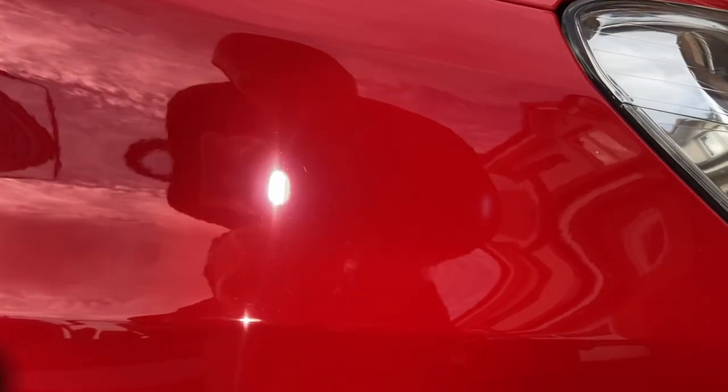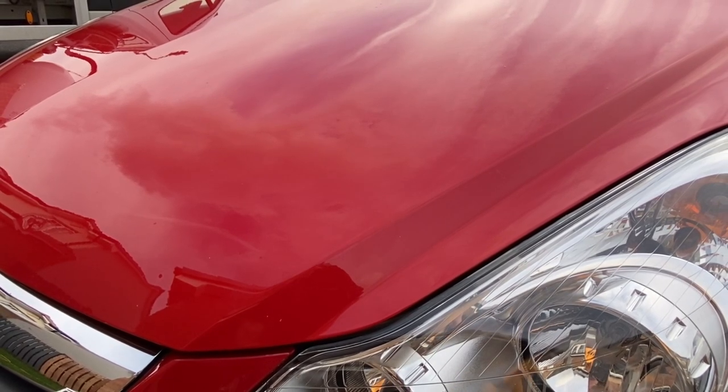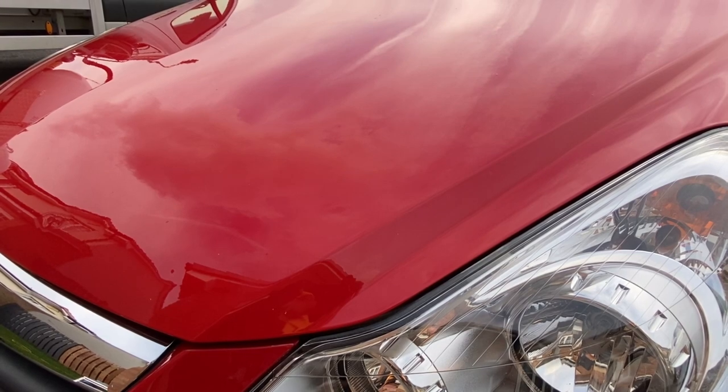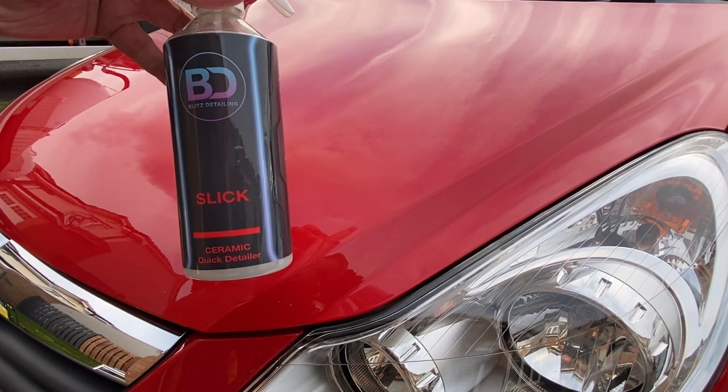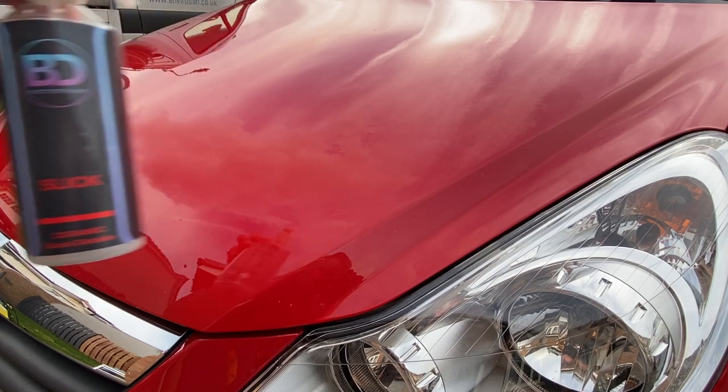The light is showing more swirls than I was getting on the bonnet with the cutting pad - that speaks volumes about pad choice rather than product ability. Clearly the pad I was using there wasn't suitable, and a slightly firmer one would have worked better, or maybe microfiber or wool. But this isn't a prep for a ceramic coat - it's an enthusiast making his mum's car more enjoyable to look at and drive, so I'm going to leave it like this. Chasing every last swirl isn't what this video is about - I'm after a smile on my mum's face. To add to that shine, I'm going to apply a layer of Blitzed Detailing Slick ceramic quick detailer for protection and gloss, with up to three months durability.